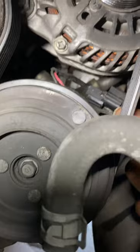Now I'm going to start the vehicle, turn the AC on, and check what's coming down those two wires. Remember, one of them is ground all the while, and then the power side gets switched on so the compressor comes on. The vehicle is running — this is dangerous. You're putting your fingers in close proximity to moving parts, so be very aware of the belt and the pulley. Don't lose any digits. Let's check for power.